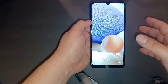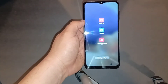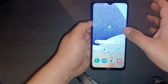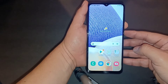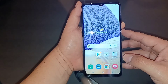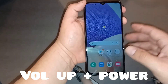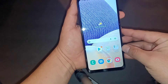The first thing you have to do is turn off the phone. If you can turn it off with the power button, just hold it and power it off. For people who are stuck on the Google lock screen or PIN screen and cannot do that, you have to do the first procedure: volume down and power button, which will turn off the phone. As soon as you see the black screen, you need to switch over to volume up and power to get into the factory reset option. Let's do it together — volume down and power.